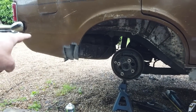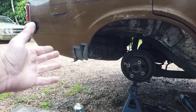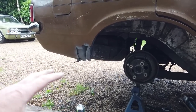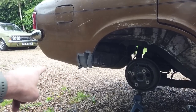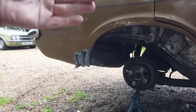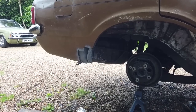You're making a slice, you're pulling some spot welds out. In fact, most of that is just cut off, especially because the back valance is also coming off. So it'll be cut and probably just rock it a bit, drill the bottom spot welds. That'll then expose the probably damaged inner piece, the inner rear valance panel.